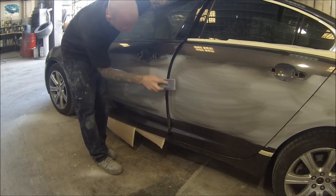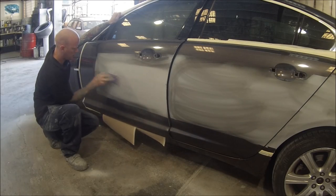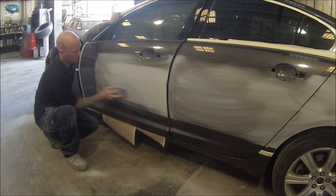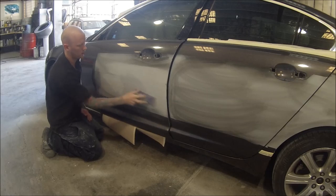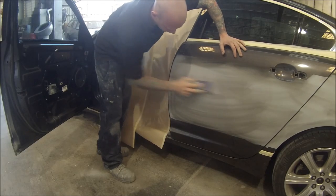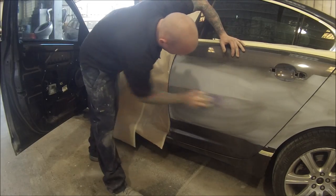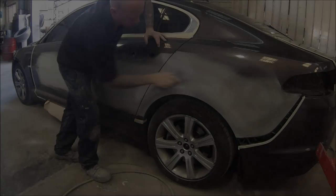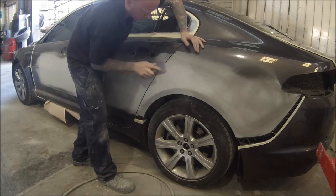I'm using 180 grit on this job. Now one thing I will say is that when you're sanding, every job's different. This job had big repairs all through those two doors, and you really want to block right into it — that's why I'm using 180. You're just using the weight of the sandpaper, not pushing any further, because these panels these days are quite thin and if you push any pressure onto that you'll end up sanding dents into it. If it was just a smaller repair you could probably go something like 240, depending on how confident you are in the panel work.